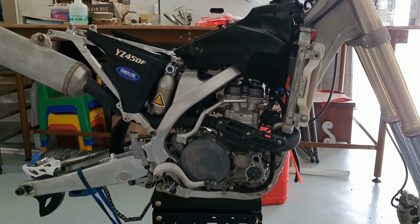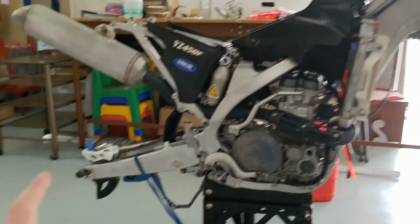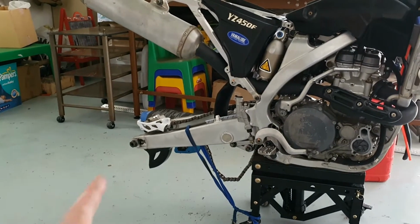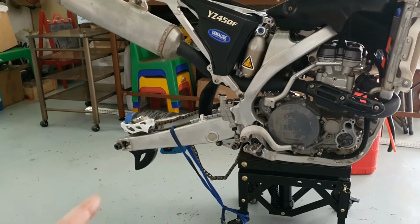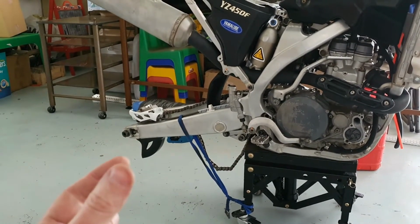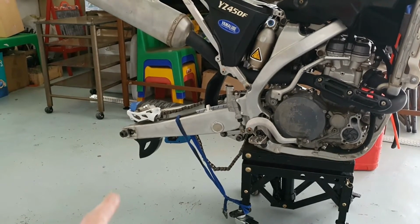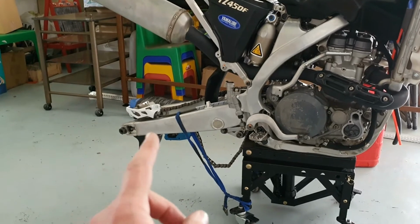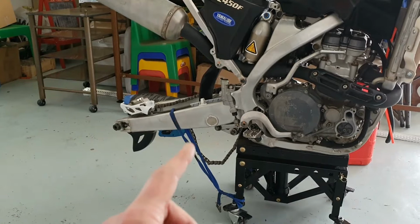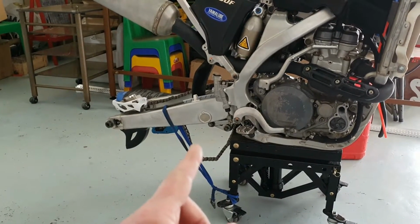Okay, let's start. I basically went from the sides. The tires were from 2008, so those are being renewed. The rear brake caliper was seized, and I'm talking seized as in the pot didn't even move. I had to push 6 bar of pressure until it popped out. Fully rebuilt. The rubber brake hoses are now HEL, H-E-L, steel braided. The brake cylinder has been rebuilt.